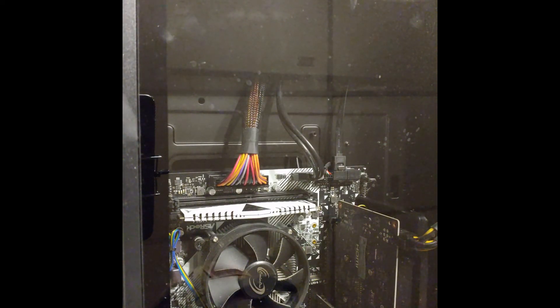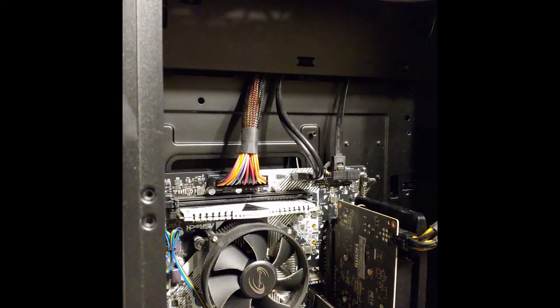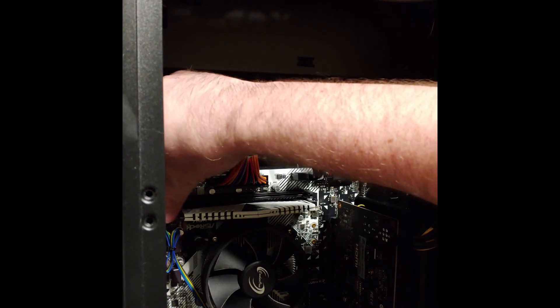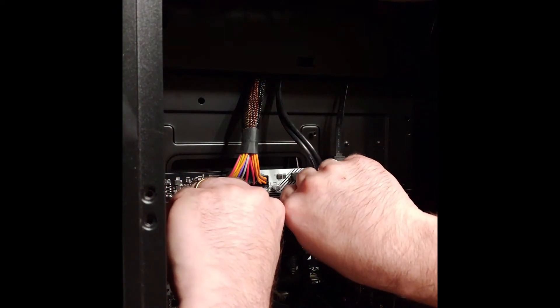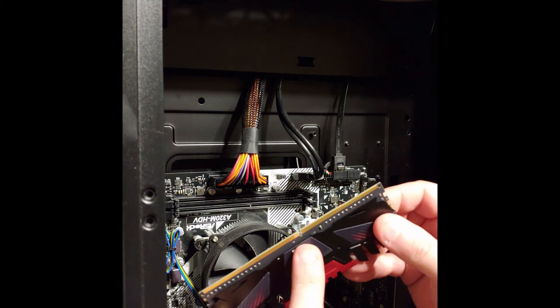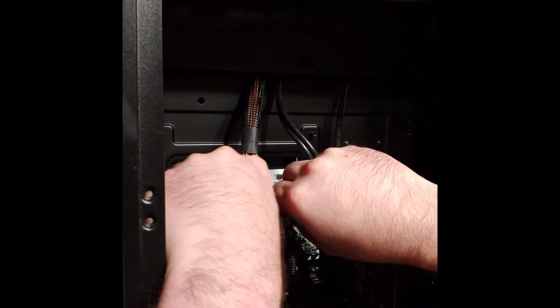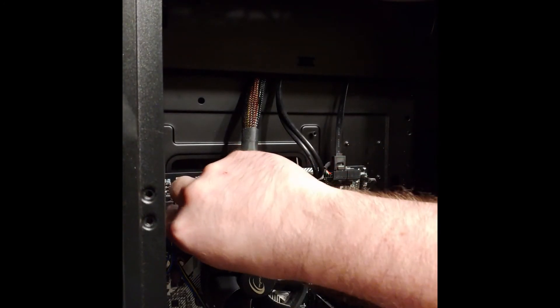I'm going to take the case cover off and remove the four screws that are holding the glass onto it — one, two, three, and four. Those come off real quick and the glass should just lift right off like this. Now this one's a weird kind of memory because it's only got one knob that holds it in place. I'll just undo that one side and it slides right out. I'm going to match up the memory stick so I know which way they're aligned, paying particular attention to where the notch is. Slide it into the groove and press down until it clicks. That one has clicked into place.